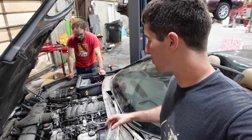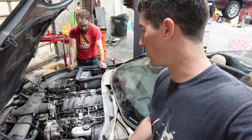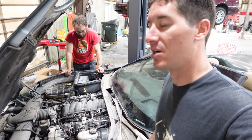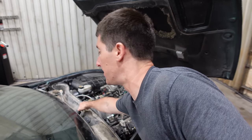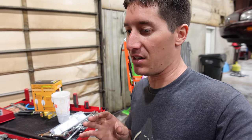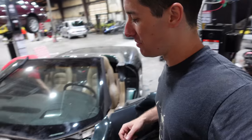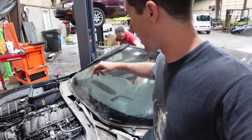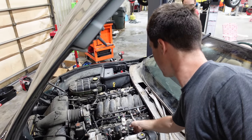As a quick test we pulled all four bolts out of the fuel rail, lifted it up, and cranked the engine for a second — all eight injectors seem to be firing in the correct firing order, so it doesn't look like a stuck-open injector. The car hasn't been driven in a long time and there's still that nasty exhaust leak you can hear popping, but we're going to take it out and drive it. We're not getting a single misfire code out of the ECU.